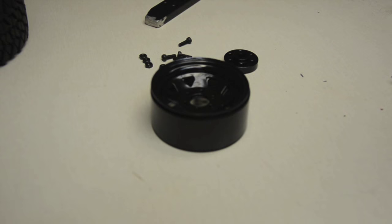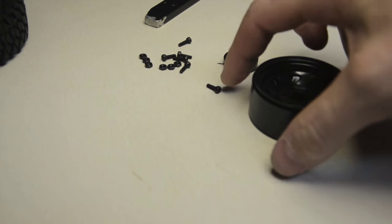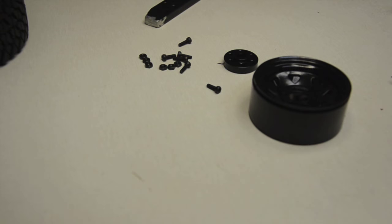The G-made beadlock wheels come with one long bolt and shorter ones for the actual finish. So you put one long one through to get it started, crank it down, pinch the tire in place, and then fit your other bolts in and put the nuts on. That works well — I did a set of G-made before — but after two wheels the long bolt had already stripped out from the force on it. So that's when I came up with my own method.